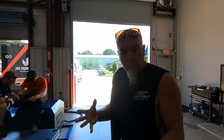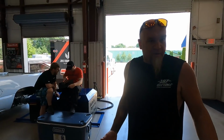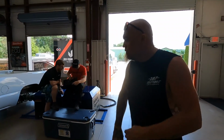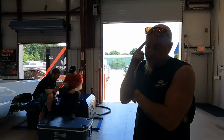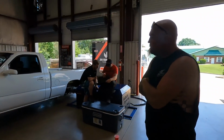Plus, we're still new to the FuelTech stuff. You wired this whole deal all by yourself, just like you did the 55. Right. So whenever we run across problems, where better to be than right here? One problem we ran into that I didn't get on video was there was actually some trash in my boost controller, and on one of the pulls we made, it hung the increase solenoid open, and this thing made 40 pounds of boost. Yeah, but it made it like that. Like in a split, yes. Like, didn't even see it on the dyno, but the FuelTech caught it in the software. So, little stuff like that.